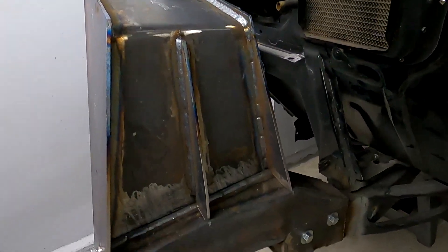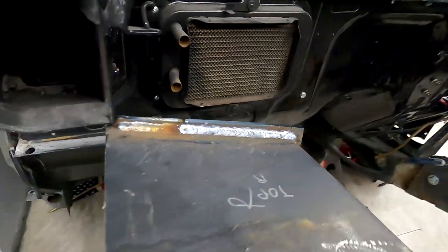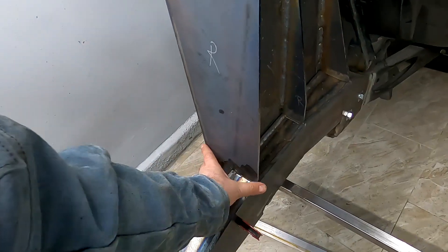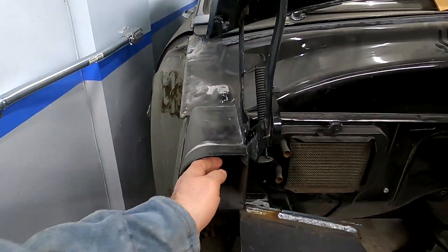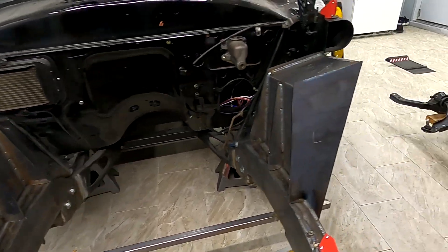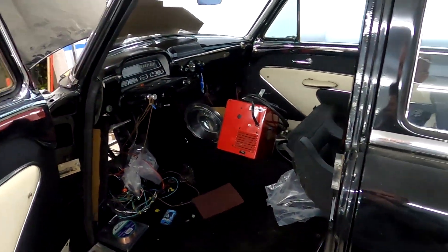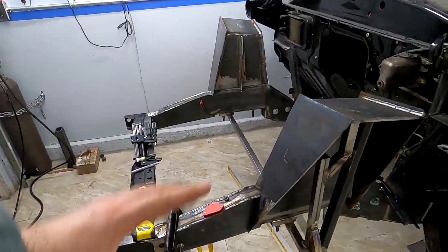The welds are just getting better and better. Next thing is I'm going to be drilling holes where the struts are going to be mounted, and then we are going to permanently weld this to the frame itself. Later on down the road we're going to have a roll cage that comes out right through here from the cabin, ties into this, and comes down this way — so it's going to be braced up pretty well. Definitely going to put a roll cage in this. Let's get to welding and permanently mounting this thing so we can put the front suspension on.